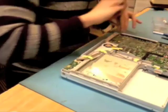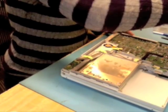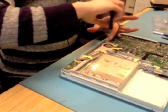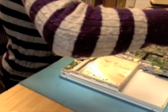and now the 4 screws that we took out, which was the whole reason we needed to remove that bottom shield. So the slightly shorter one goes in that front left corner, and then my 3 long ones, one goes in by the logic board next to the fan, one goes in by the sleep light.